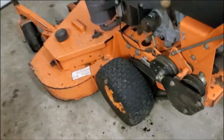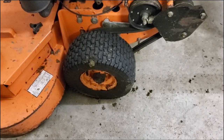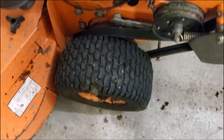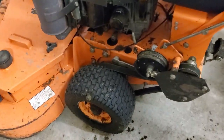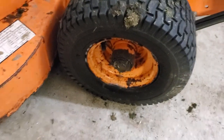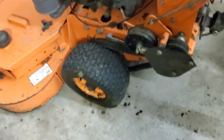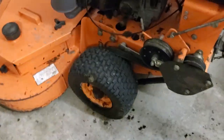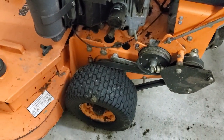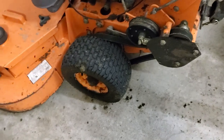In the meantime I'm going to try and find the leak in this tire. It's got a slow leak - every couple of days I go to the shed and it's gone flat. I'm assuming it's a bead leak because I don't see anything puncturing the tire. I sprayed some soapy water on it and wasn't able to see any leaks, so I think it must be coming from the backside. Either way, I'm just going to put some slime in it - that should probably fix it. You could use bead glue for a bead leak, but I'll probably just slime it.